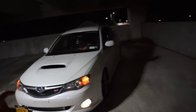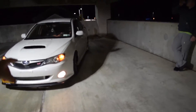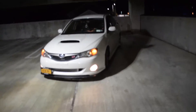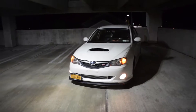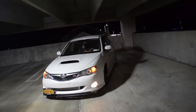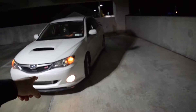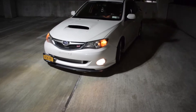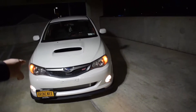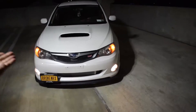Front end — what have I done to this? I did a rewire so that I can have my fog lights on without having my daytime running lights or any other lights on, so I can just run fog lights and side markers if I want. That was a simple jump over to a fuse that's got constant 12-volt with keys on. I did the GrimSpeed license plate relocation bracket, a mock STI front lip from eBay — it's like 70 bucks, does the job and looks good. Also we have the STI grille, which is definitely an improvement. I'll insert a photo of the stock grille — it's terrible.